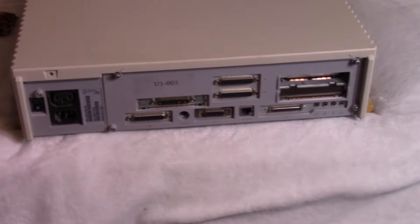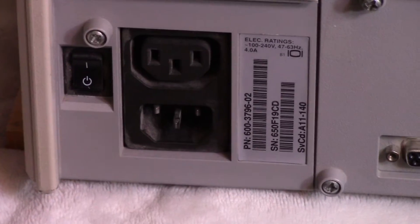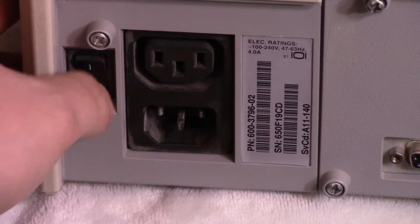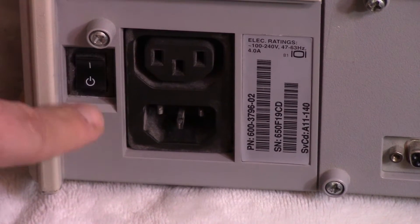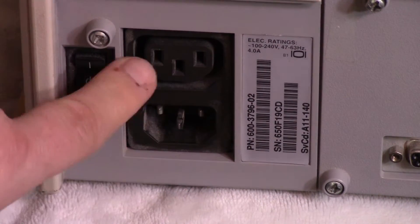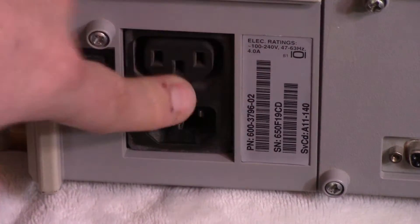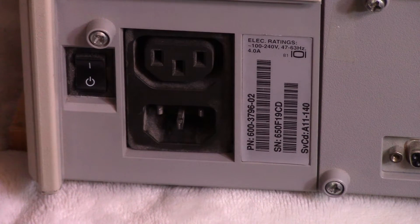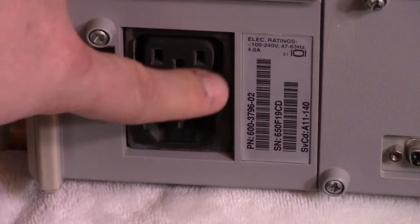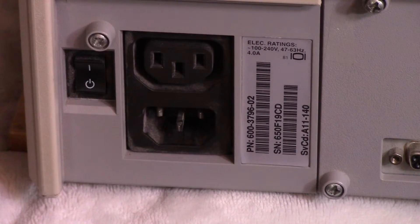Let's take a look at the back. Here's the back of this machine. There's a power switch — it flips back to a neutral position rather than staying in an on or off position, which is interesting. Right here we have a male and female three-prong power connector, so you can run power in and then plug a monitor into it. When you power the machine on, it gives power to the monitor too. I always like seeing that kind of pass-through setup.